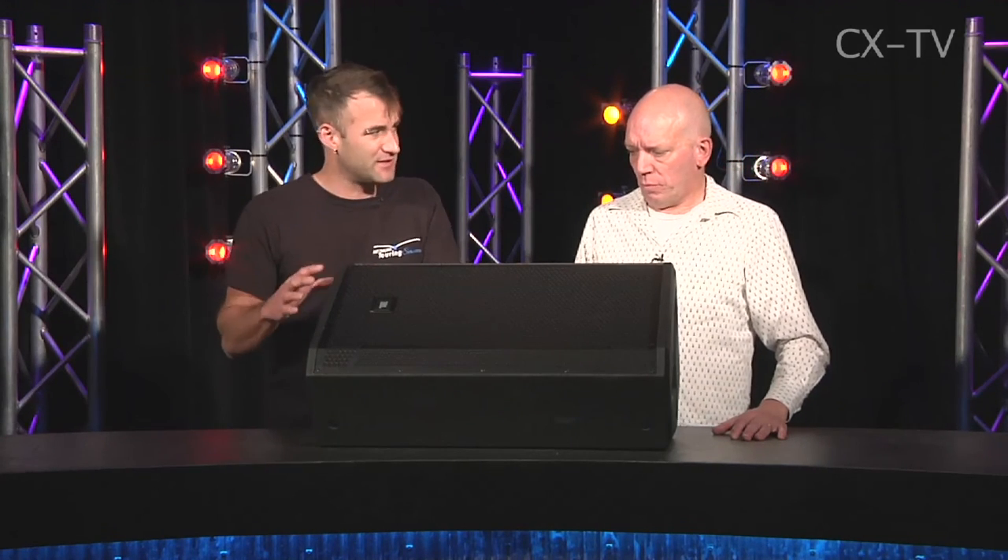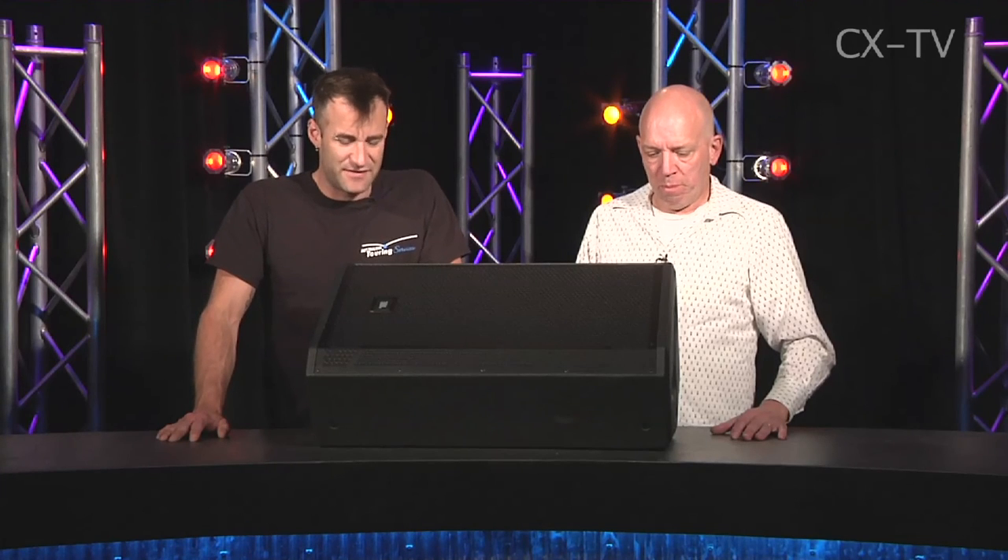The interesting thing about this in passive mode straight out of the box — characteristically JBL stuff seems to be a bit peaky around the 3K region, but this doesn't have that. It does seem like they've shifted the peak downward a little bit, around about 900 hertz. Pull one little notch out and it's very polite as a monitor, and very nice as a cabinet for playback or live. Tough and professional — you can definitely stick a lot of power into these things without causing them any undue harm.